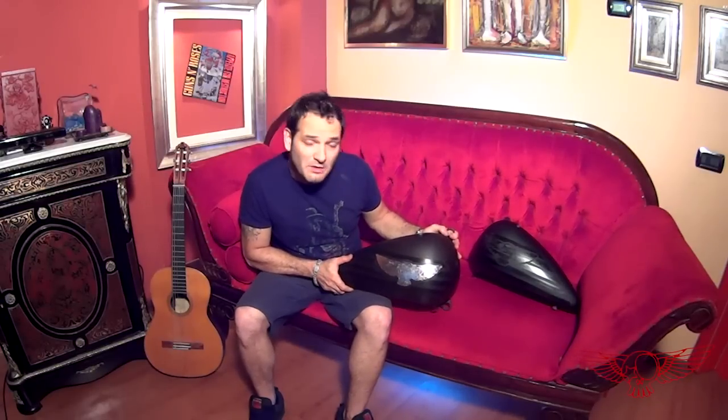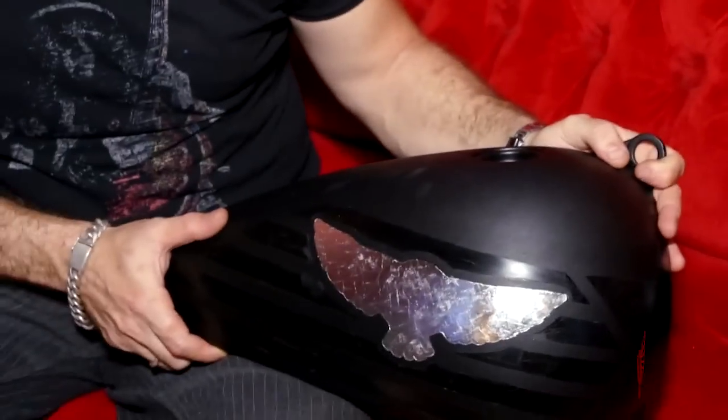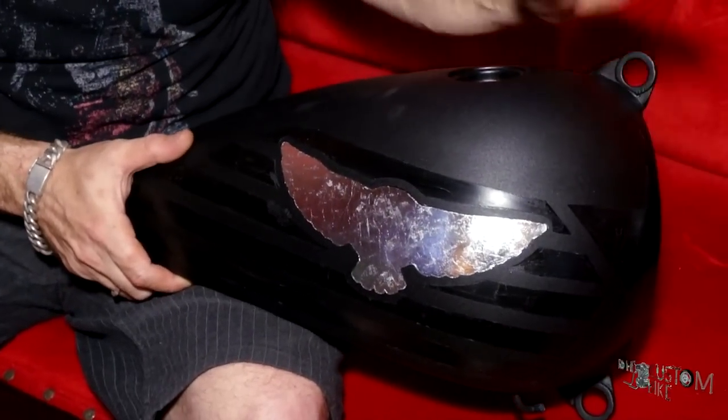So these tanks — both of them — will have to be sandblasted again and powder coated from the beginning, both layers, including the masking and everything. I forgot to remove the masking tape right after flow-out, and the bottom layer melted and took the shape and wrinkles of the tape. All there was left to do was start the whole process again, starting with stripping the paint.